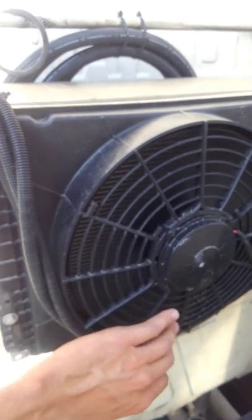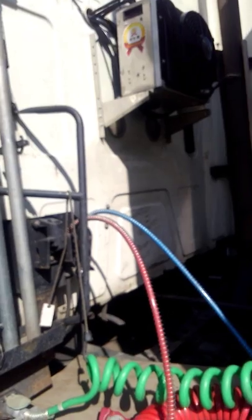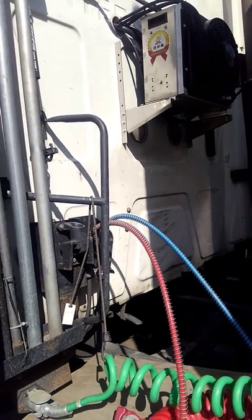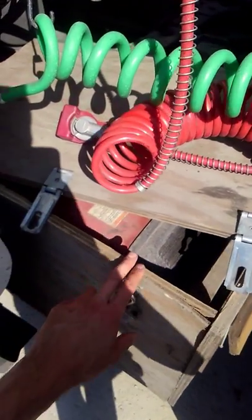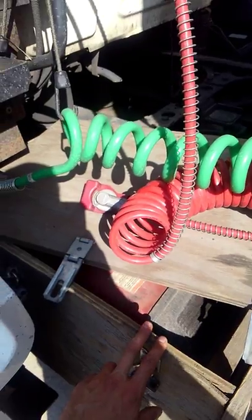You can set it up however you want. The outside fan, I wouldn't say it's loud — it's definitely moving a lot of air. I'm very satisfied with the unit. The guy selling these on eBay, hopefully he can keep them listed — for $660 it's a very good unit. If you want to get an APU anywhere, you're going to be paying many thousands of dollars. I'll be posting a link to the eBay listing. Everything comes included, including the long heavy gauge wires to your battery. Obviously you don't run it off your battery alone because it's going to die in an hour or two. You need a generator, or a battery pack rated for at least 3 to 4 kilowatt hours of power to get you through the night on this system.